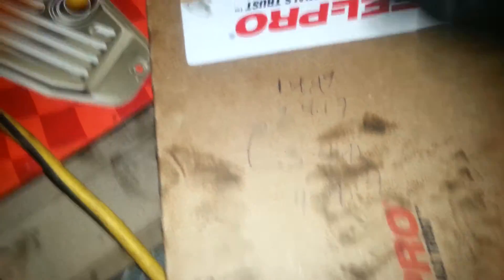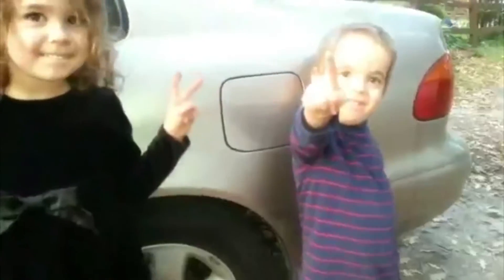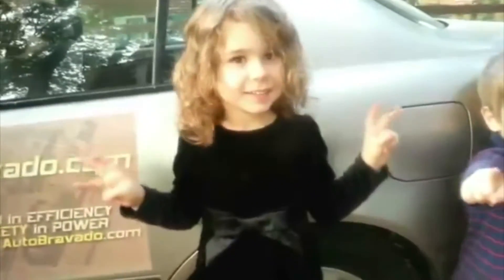Just to take you through the concept briefly — all these parts we've installed today. I can't believe it; just while he bought the rest of it, I put in the radiator. I feel really good about that, I just had a couple of bolts left. What I do is measure the four spark plugs — the ohms of resistance across the core. One, two, three, four.